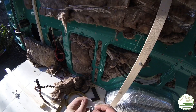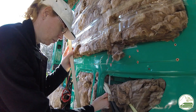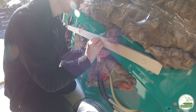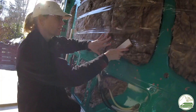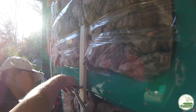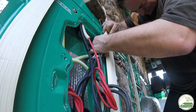All in all, putting the battens in was a very time-consuming job, and this is definitely a two-person job — I tried to do it alone but failed miserably. There is hardly any room to work in these very tight spaces. It took us forever to get every nut and bolt secured and we had to use every trick in the book. We duct-taped nuts on wrenches and used magnets on sticks to get the nuts into position on the inside of the metal ribs. Every time a nut fell out we had to find it — often using magnets on a string. You can't leave loose bolts rattling around in your van or causing rust. Profane language was used repeatedly during this process.